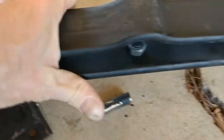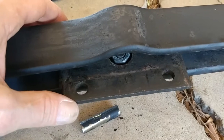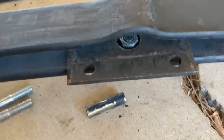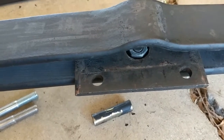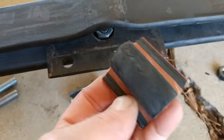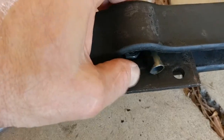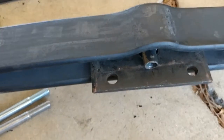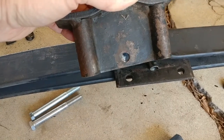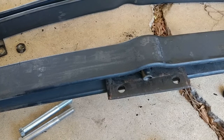Once you've done that, you've got to take this big old bracket, fit it in here, make sure that it's down over top of that nut. In theory you put a nice little rubber gasket in here that serves to cushion the stuff above it. I don't have one of those because my car is all broken and falling apart, so I cut out a piece of bike tube. The idea is that goes in, then this pivot piece has to go in — this is the pivot that the bolt goes through — and that is how the anti-roll capabilities of the car are enabled. Everything rolls around this pivot and bolt.